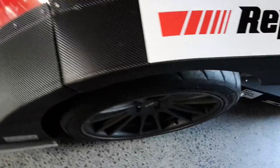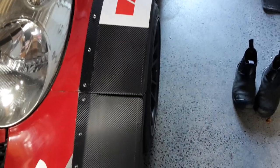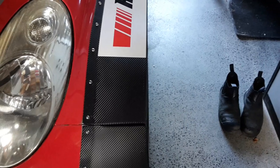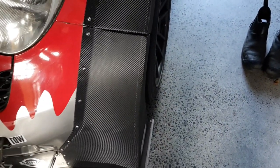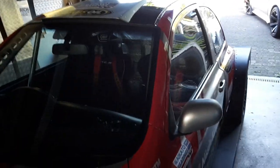We're all sorted there. I'm going to have a look at what I can do to keep our tires inside the guards — that's the Motorsport New Zealand rule. At the moment we've got 235s on a nine-inch wheel; we're going to 275s on a ten-inch, so they will be wider and will probably protrude from the flare just a little bit. The quickest fix is to put a small lip all the way around the outside of the flare to make it legal, though I'll work on something a bit nicer.